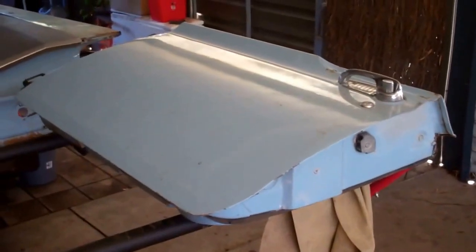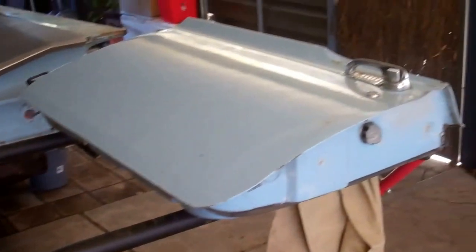I'm going to be doing these two doors at the same time. This is the driver's door on its way to getting done - it's just been completely stripped back to bare metal, back and front, and I've got an etch primer on it, just hanging up here drying. Quite incredibly, this is one panel which really needs very little work. There's only one little spot of rust which I have to fill in with a bit of welding, but other than that it's all good. There are no hidden surprises on this door - no body filler, nothing. Just all plain metal. So hopefully the remaining doors are in the same shape.